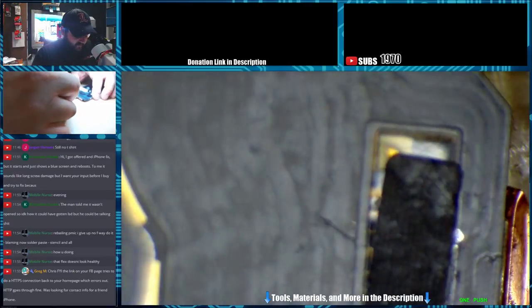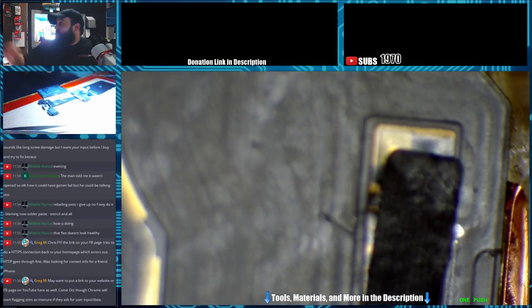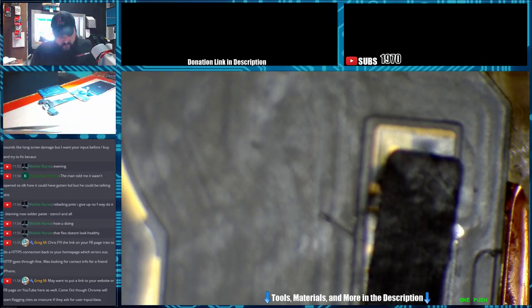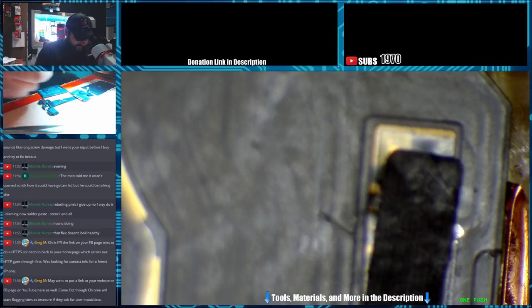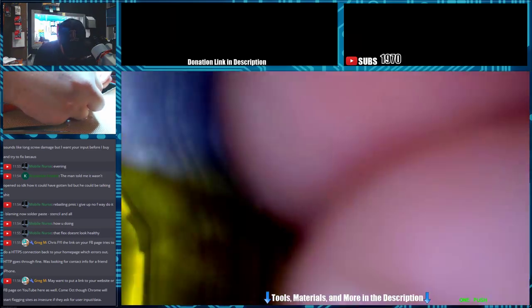That's conductive. Let's put a piece of Kapton tape down underneath that, since that's not completely covered. That's an EMI shielding cover piece. I wonder what testing they do while they're making these to tell if the EMI shielding is needed or not, like the tape they use. Or they just use it in specific areas, maybe where there's high switching frequency ICs or something. I always kind of wondered how they determine where it's needed, where it's not.